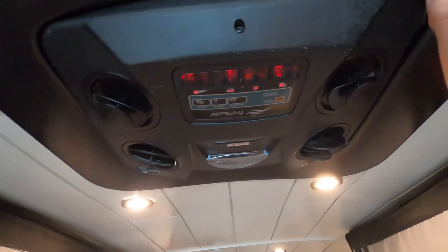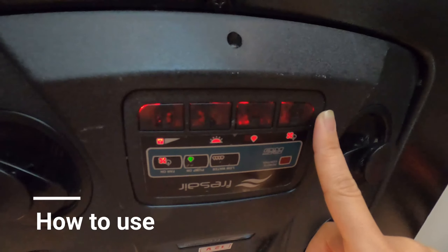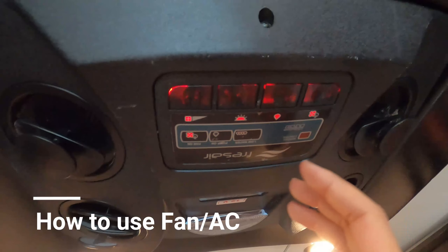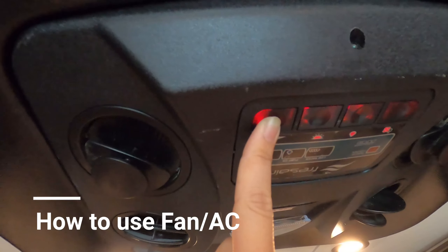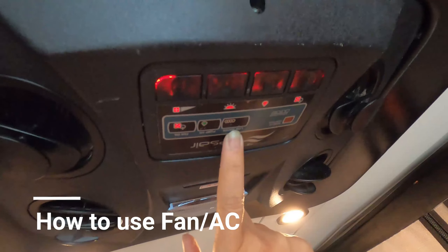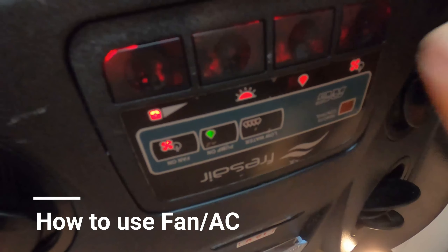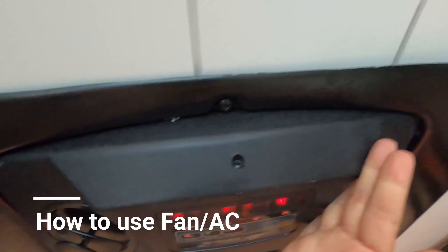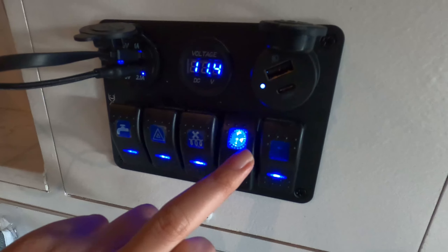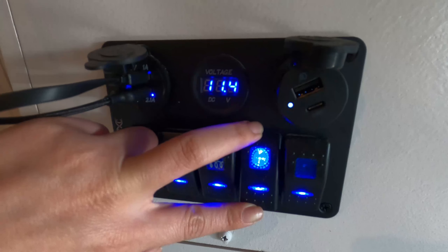On top of the van, here is the AC unit. To turn the AC unit on, you simply tap this button once. You can hear the AC is working. To change how much air comes out, you simply cycle through this button and you'll hear more and more air. Once you see the low water indicator — which has four water drops — if that one starts flashing, the water tank for this unit is getting low. In that case, press this button to allow water to travel from the big water tank to the smaller tank that works for the AC. You don't need to leave this on for very long, maybe 30 seconds. Once the water is filled up, that light will disappear.